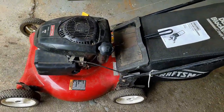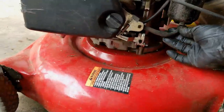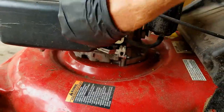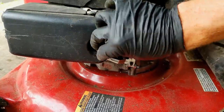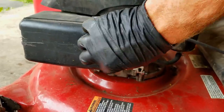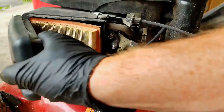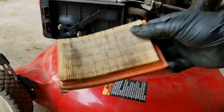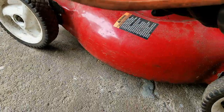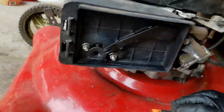She's saying that when she puts fuel in it, it leaks. She thinks it's coming from the fuel line, but I'm not sure — I haven't seen too many of them leak from the fuel line. I asked her specifically where it came out from and she said from where the air filter is, so that's why I don't think it's coming from the fuel line. It does smell a little bit like fuel, but I don't see any real major fuel issues just looking at the air filter.